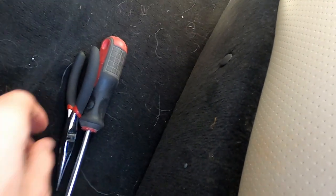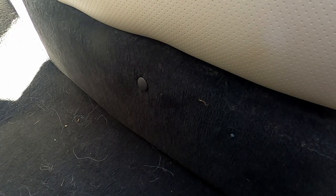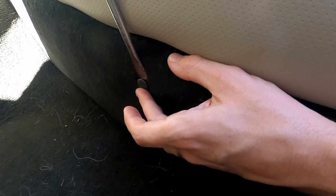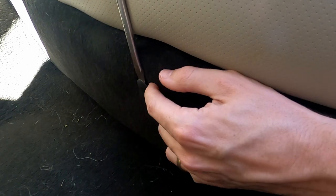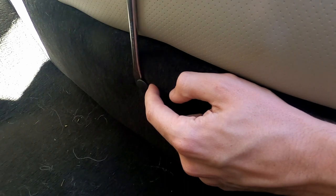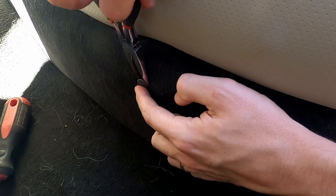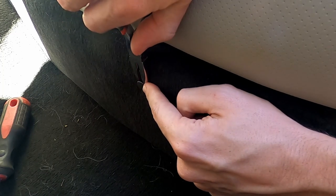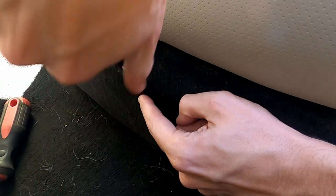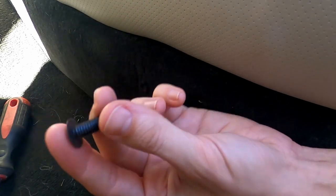I'm going to show you what I was talking about when it comes to using needle nose pliers to remove those plastic plugs — it's a pretty reliable method. Step one is to get the head started; a chunky flat blade will do that. You can get underneath and just twist a little to get the first section out. If you use the flat blade for the rest and you're not careful, you can break the tabs. I found that needle nose pliers work quite well — get on either side, grip firmly but not enough to crush the tabs, then lean it forward and it pops right out, nice and intact.